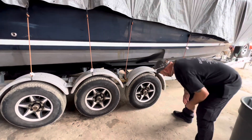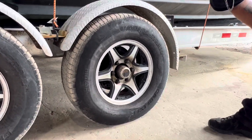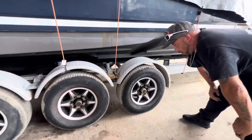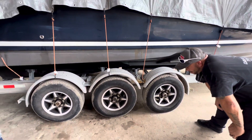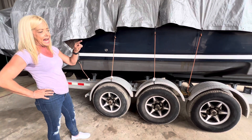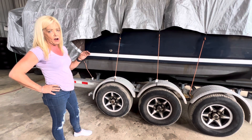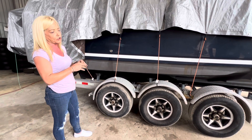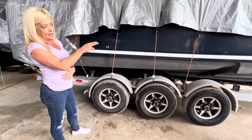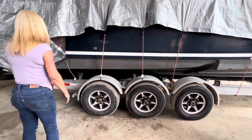I think it has a lot of extensive damage I'm seeing on the rotor itself. So we're probably going to strip it down to the spindle and put new six-lug hubs — new hubs, new rotors. This is currently set up with UFP. It's interesting because he has an actuator on his trailer — he does not need that, because he does have the electric-over-hydraulic unit. So at some point this trailer had surge brakes from an actuator, then they upgraded to an electric-over-hydraulic. We'll go through all that and fix it the way it needs to be.